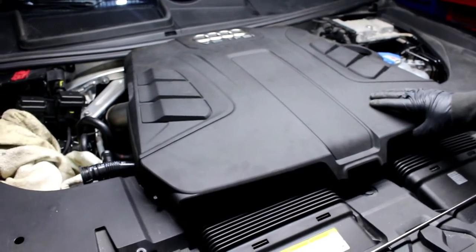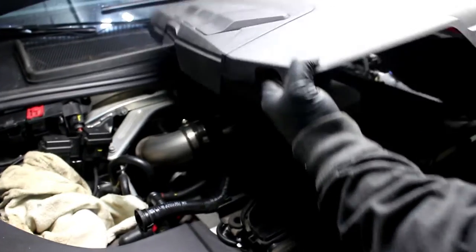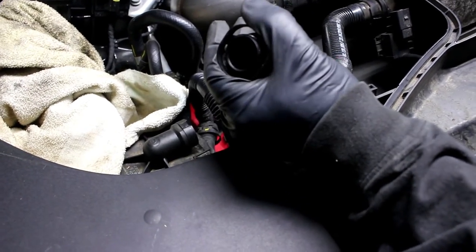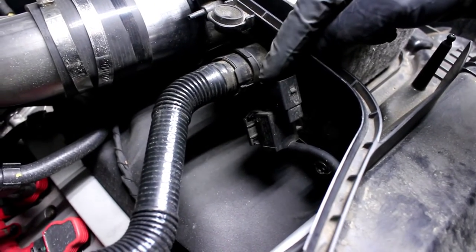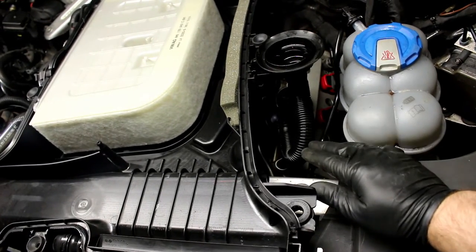On the side of the air box, you'll notice these pins. You're going to pop the pin on here, and then on the other side it's exactly the same thing. The top of your air box is going to come up and off. You want to take the PCV hose off — there's a serrated top and bottom; you squeeze and the sides bow out, which helps you remove it. There's also an electrical connection to the solenoid that controls the front air box flap. Over here you've got the oil fill extender.